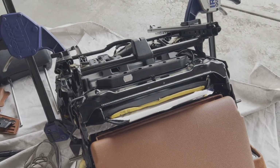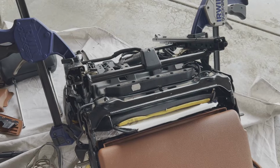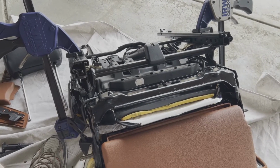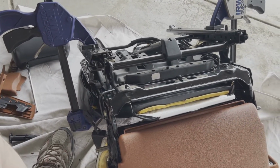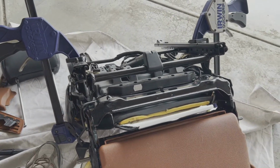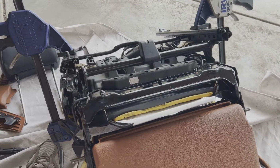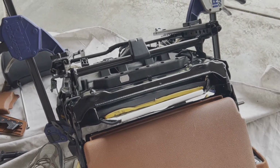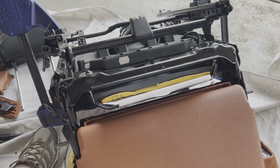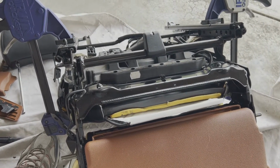It's time to secure the back edges of the two upper and lower skins. So what I found is that because the bottom seat is spring-loaded, bar clamps bring it up to full tension, and squeezing those springs all the way down as far as they'll go makes it a whole lot easier to stretch this rear and get it mounted.